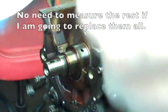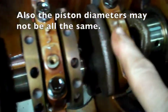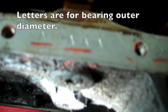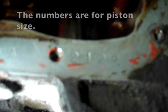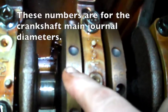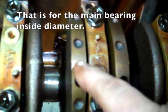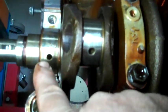If I have to get one then I'm just going to get the whole set. Now I need to figure out which main bearings I need. These main bearings on these Suzukis are not all the same. I need to use these codes. It says A B A A A, and then over here it says 2 1 2 2, but there's a 3 3, and across over here there's a 2 2 2. So that means the one I took off is a 3, this one is a 3, this one's a 2, this one's a 2, this one's a 2, and this one's a 2. And they are also color coded.